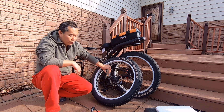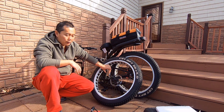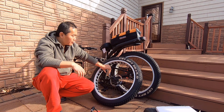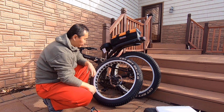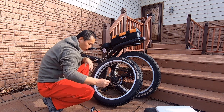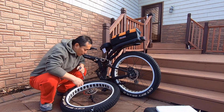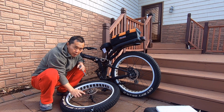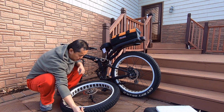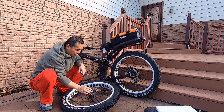This is the most tricky part. If you can find a company that sells your spoke and it's not the right size, you can get a replacement - that would be great. Otherwise you're going to end up with different sizes of spokes like me. Then I'll undo the tires - basically you're going to push out the air pressure. And you need to take out the disc for your brake. You're going to put the disc back right here for the brake. This is sometimes really tight - you've got to be very, very careful to take it out, otherwise you can damage the disc.